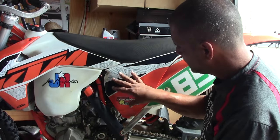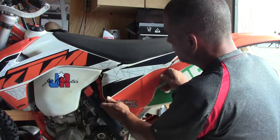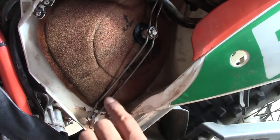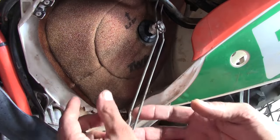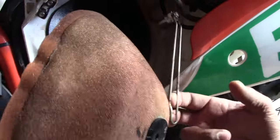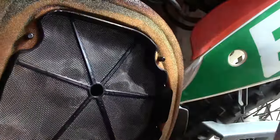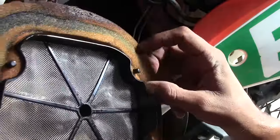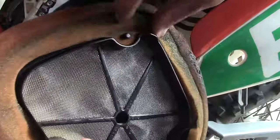For those of you who don't know, your filter is in this compartment right here. You can just pop this cover out — this little plastic cover — and just work it off. It comes right off. And then there's your air filter. The filter's held in by this rod that kind of keeps tension on it, pushing it in at the center. You can just push it in and unclip it down at the bottom, pull it out, and then you can pull your whole air filter out. It's going to have the screen and this frame attached to the filter.